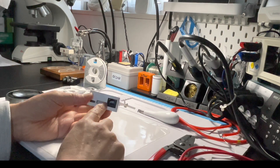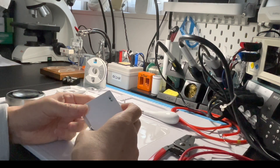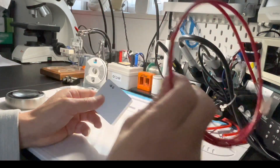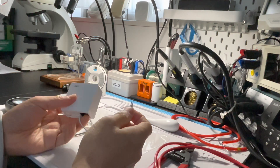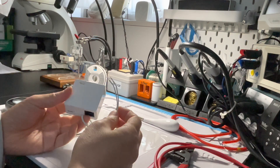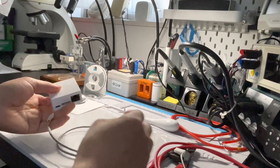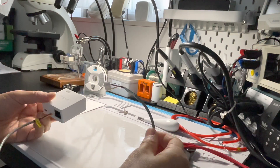We supply the wires to connect with the indoor unit if needed. When you get the adapter, normally you will only get the adapter itself. You will need to prepare the power wires and the CAT6 wires yourself. But normally, if your air conditioner uses the mini-6 solution, you will see these wires together with the adapter. These two wires connect with your original remote controller.